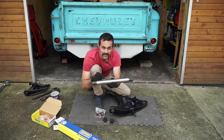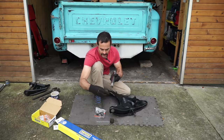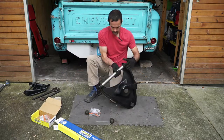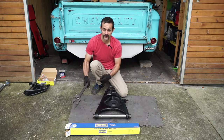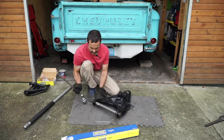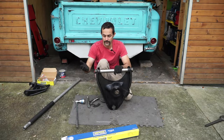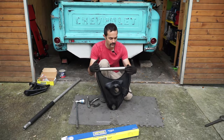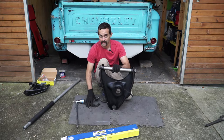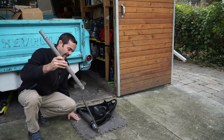So this is what you need for the lower control arm, and this is the important part — this part has to go opposite the side of your shock mount. These are the big caps that go in. Put your rubber seals on, and once your seals are situated you can insert it in here. For this arm you're not going to use open-end wrenches — you are going to need a giant one and five-eighths inch socket. Turn that way, then turn that way, keeping it in the same position. Both sides really need to go at the same rate to keep this floating in the middle.